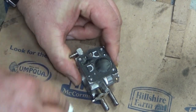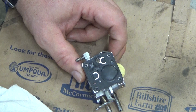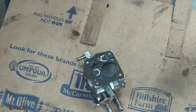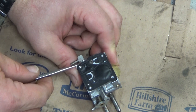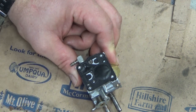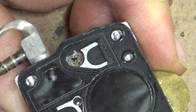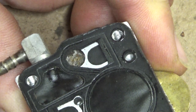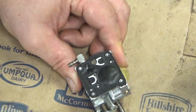I'm already glad that we popped this. This is the fuel inlet screen right down here. See all this garbage? That is stuff that managed to get past the fuel filter somehow. We definitely want to clean all that crap out.